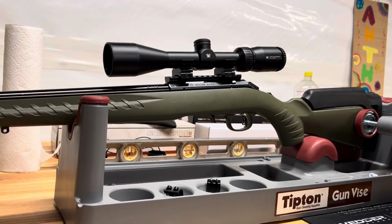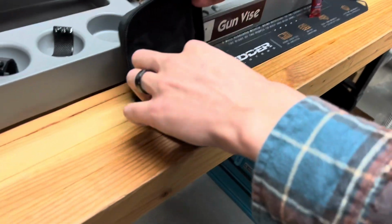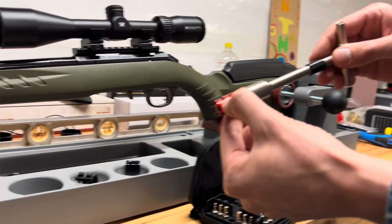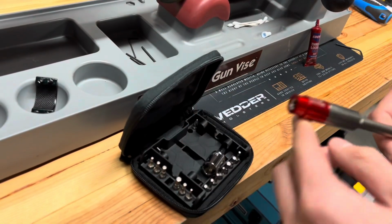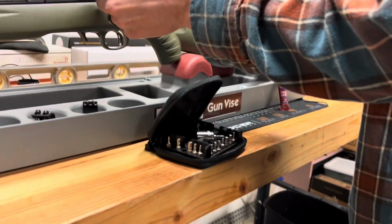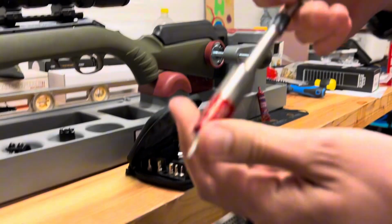And for that, I have Fix-It Stick. If you guys haven't seen these, they're awesome. It's got my little torque driver here. So for 30 inch-pounds, we're going to go right in between the 25 and 35 here, and that's our line to know where we are. So pretty cool. I'm going to find the bit here and torque these down. So this one. Nice. All right, and then that just sits in there, and then you torque it down.